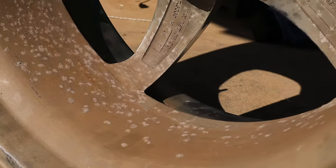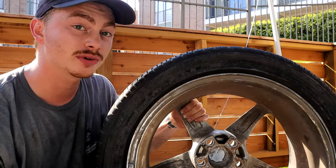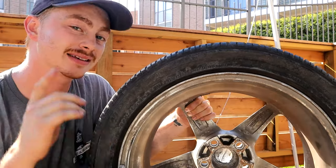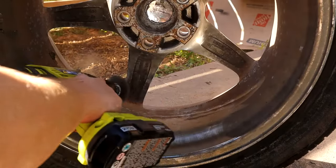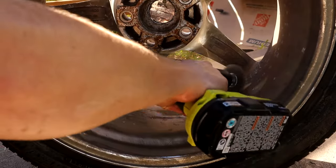The back side of my wheels is super dirty so I'm actually going to be starting there, but if you want to skip to the wheel face then go ahead and skip to this timestamp. First I'm going to take a wire wheel brush on my drill and I'm going to remove all the initial dirt and gunk on the inside of the barrel.